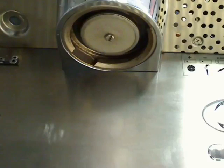In this session, we're working on a Rancilio Class 8 DE2 group automatic, and we're going to be focusing on the portafilter gasket, otherwise known as the group gasket, and the dispersion screen, or diffuser screen. We're going to remove the screen and also the gasket and replace that.